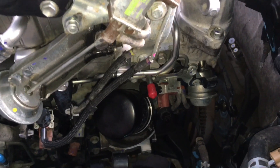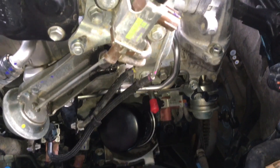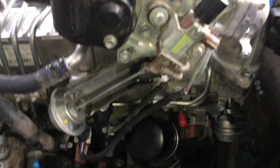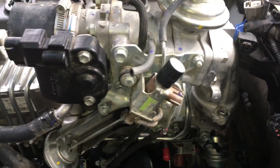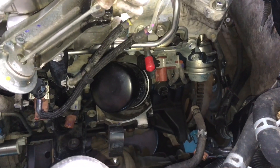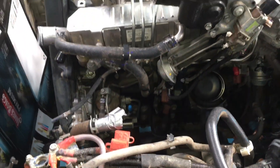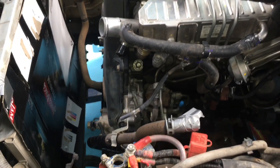All right, now we can go down slowly. I can feel it touching — the front axle, that'll be fine. That plug — no problem anyway, it's going to get better as it goes down. Slowly, slowly — tickling and wiggling. Always good to keep it moving slowly. Get ready to stop it going down there. Now it's a good time for me to slip in the engine mount on this side. That's sliding beautifully.